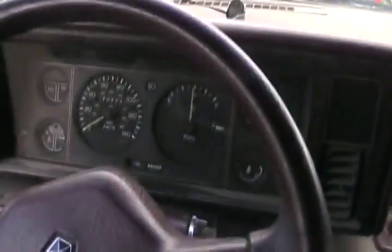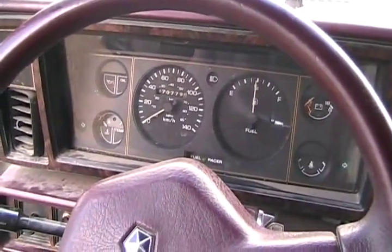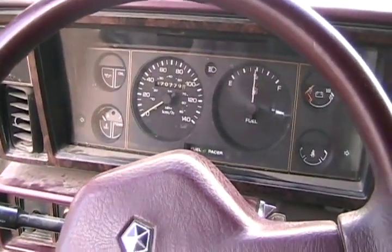The only disadvantage is that the injector pump is starting to get a little bit of corrosion and leak a tiny bit, which means fuel bleeds back to the tank, so there's an airspace in the injector pump every time it sits a while, so it doesn't fire up right away like it used to. Anyways, cold start lever down, clutch depressed.